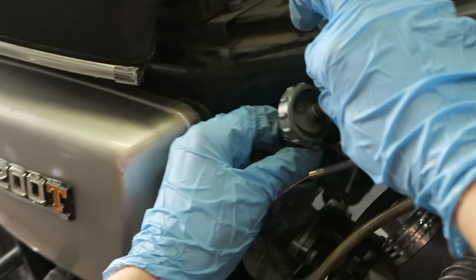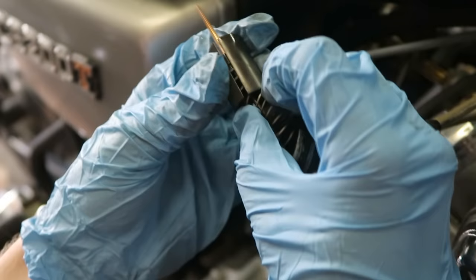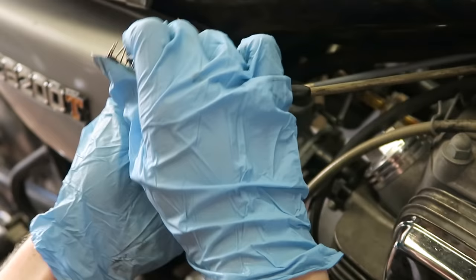The process starts at the tops of the carburetors. I've got two carbs, so I unscrewed the top of them. They are spring-loaded and the throttle slide assembly comes out. You have to compress the spring to get the cable slack to allow the stopper to remove from its little position, then you can remove the spring and set everything aside. I was careful not to mix up the parts from the carbs — keeping the right ones with the right side and the left ones with the left side, just so I wasn't introducing any extra variables. But they came to haunt me anyway.